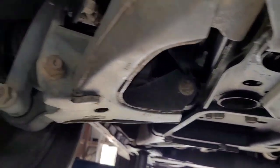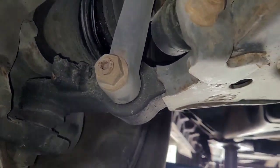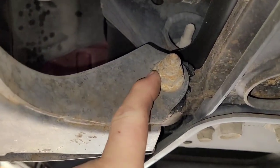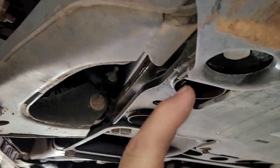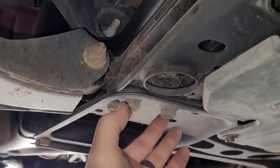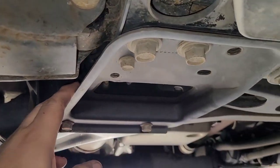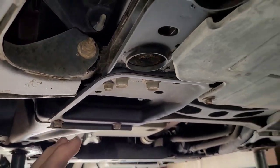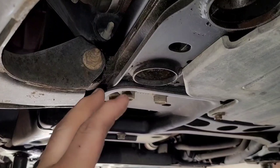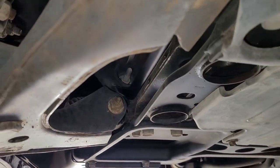So we're going to go ahead and start changing this. Now the recall way back when doesn't apply to this — that's way too far away. You don't have to worry about undoing anything in the suspension here. You can see the CV boots, but that's not of importance. You basically just have the lower control arm mounting points here — this is part of the lower frame. You have mounting bolts here and here. I think you have a set bolt somewhere here too — you may have to take this rear piece out. It's been such a long time since I've done one of these, probably 15 to 20 years.